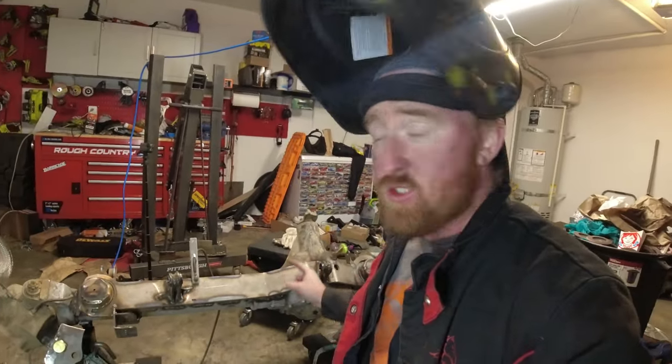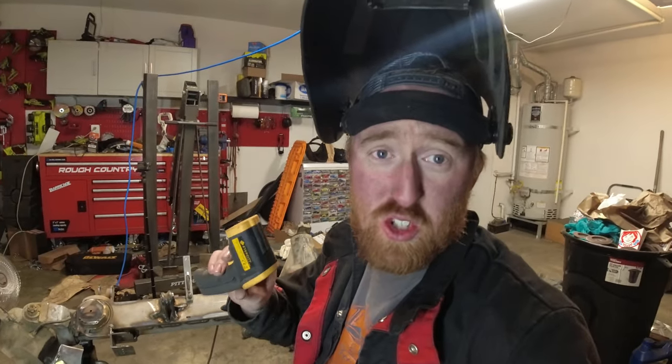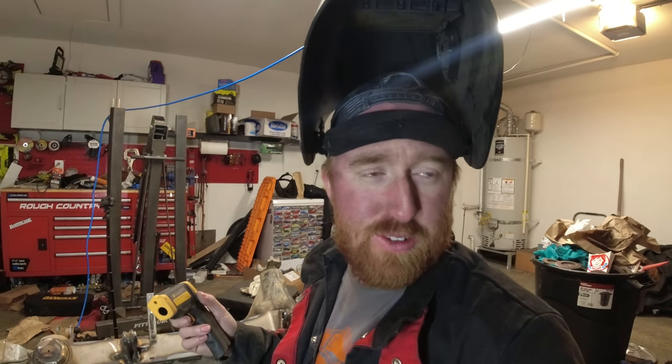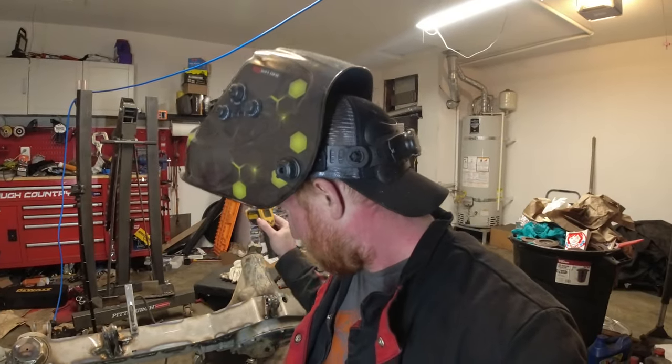Now that everything is welded completely to the cast, now is the time we go back and forth checking the temperature over and over again, making sure that the mild steel doesn't cool down faster than the cast steel, and make sure it doesn't cool down too quickly. It is currently 35 degrees outside, and it is probably just barely above that in the garage because the door is open to make sure that none of the fumes go inside.